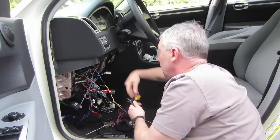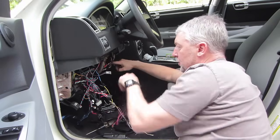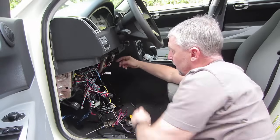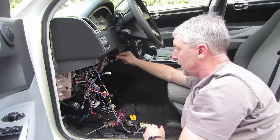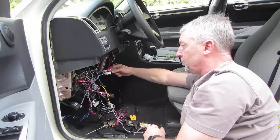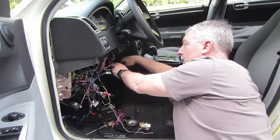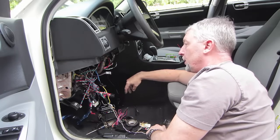What you need to do, in a nutshell, is just trace it back. The orange wire doesn't mean anything. That's just the wire that grounds the relay to open the coil. The red and the black wires, you need to take these, strip them back, and either solder them back together or put a butt connector on there to make that connection secure again. And also pay attention that there's most likely, for a remote start such as this, a wire attached to one side of that starter wire, which will further complicate it. So make sure you cut behind that and insulate it, of course, when you're all done as well. It's important.